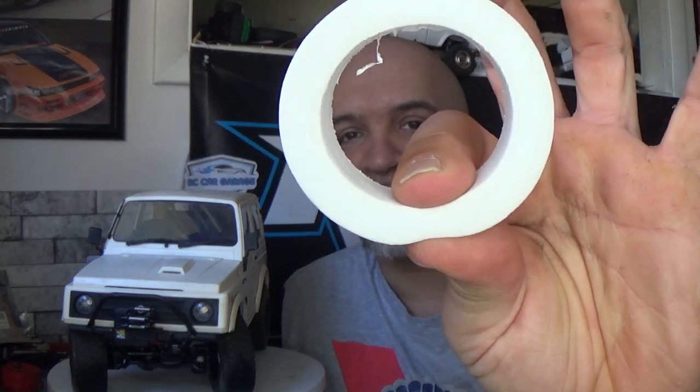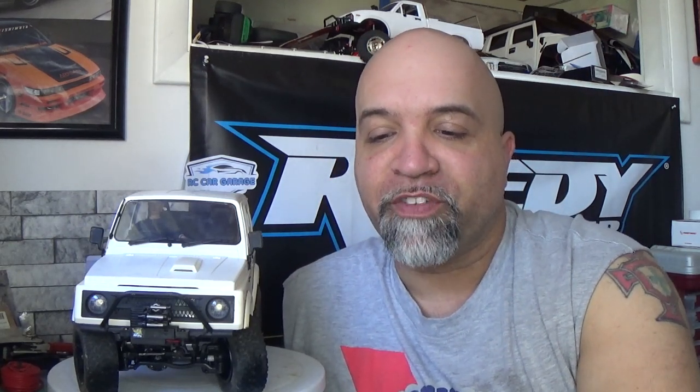The other thing I'm glad I did was take the foams out of the tires. They're just way too stiff and weren't giving the tire any flex at all — even though there's not much flex on this tire, it wasn't giving enough flex to crawl up stuff. That's a good thing. One thing I think WPL should add to the Res V3 instructions is that it's recommended to run at least a 10C discharge rating battery and to use the external wiring that comes with the kit, so you won't have any issues.